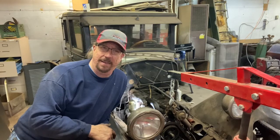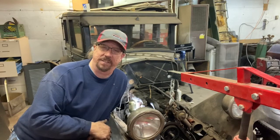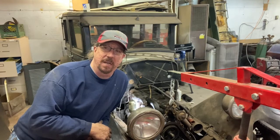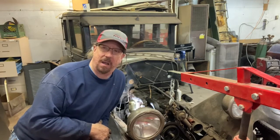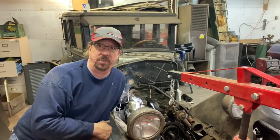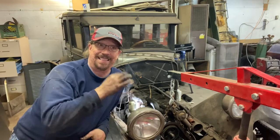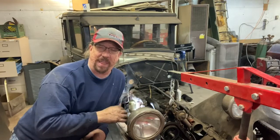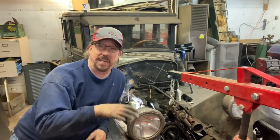We had a couple of frustrating moments. If you remember back on a couple of earlier episodes, we talked about the difference between the wedge style and the C-clip style valve keepers. I couldn't remember what the whole deal there was, but finally remembered that somebody had put one wedge style valve in cylinder number 2 on the exhaust, and I had used that retainer, which is different than the C-clip style, and that's in one of the other episodes. I do remember showing you that. The other one, somebody had taken a wedge style valve and cut a groove in it to use a C-clip, and so I thought that I had actually used a wedge style retainer in the wrong spot, but it turns out it wasn't. I pulled that one back out, back towards the back on cylinder number 5, and it was fine. So not that it was a big deal.